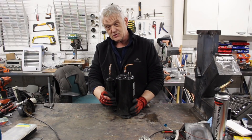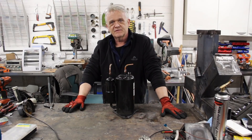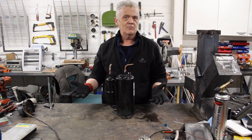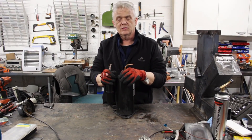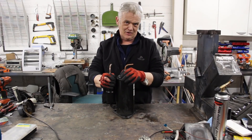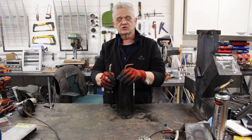On another video we did, we took a fridge compressor apart. We did a fridge compressor because they're just so easy to get hold of. Visit your scrapyard and there'll be plenty of decommissioned fridge compressors, probably in a big pile, and because they're in a great big metal shell the material in there is going to be in beautiful condition. If it burns out it's going to be the plastic in the motor that's burnt out. Compressors are just splash oiled, there's no bearings, they're all bushings, but they are a source of marvelously engineered parts that you can use to make motors out of — I've seen all kinds of motors made out of them: two stroke, four stroke, steam engines, just a load of things.